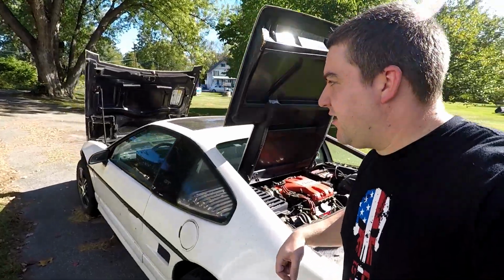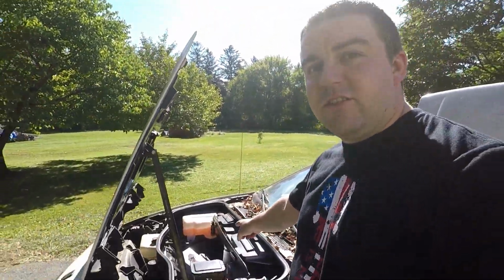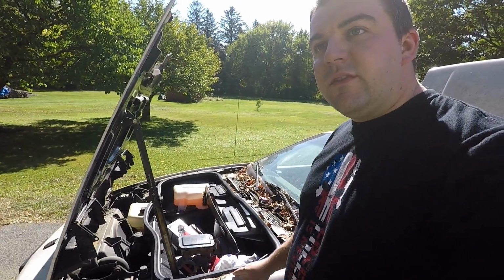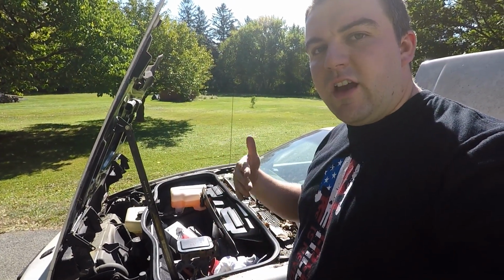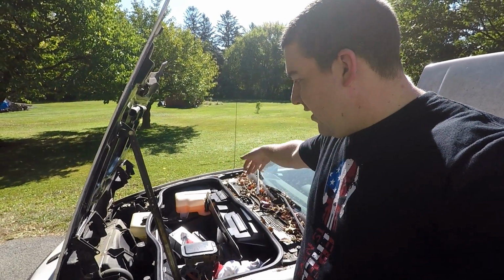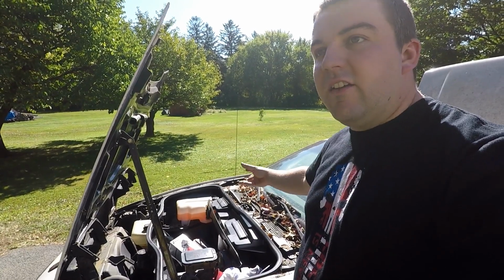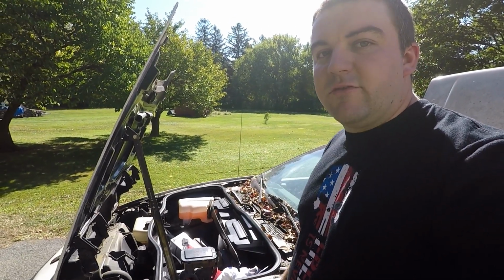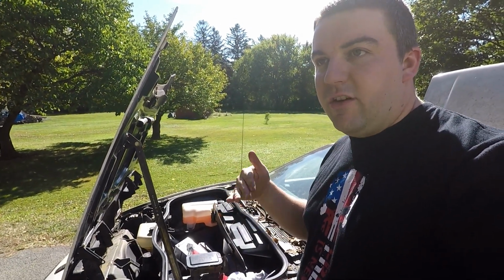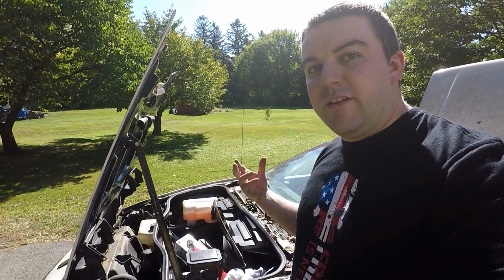The other place, which is kind of common with a lot of vehicles, is up front here. There is the resistor for the AC controls, so the different fan speeds. Those resistors go into the air ducts, but if the car has been sitting at all, creatures can get in there and put stuff by those resistors. So when the resistor heats up, if you have it on one of the lower fan speeds, the resistor heats up and then catches fire.